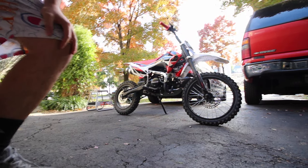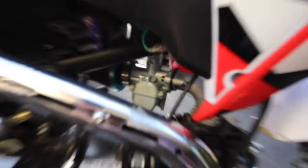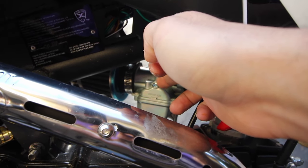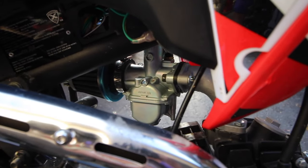So we know the issue is probably coming from the carburetor. It could be the throttle screw right here that we can adjust. If you guys can see it, it's this little screw right in here — that silver one that my middle finger is touching. That is the idle screw that we're gonna mess with first. After that we'll check the spark plug, make sure everything's good and the gap is good. That's the first step if you still can't resolve the issue.